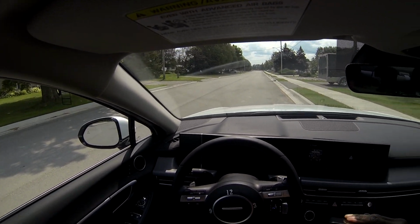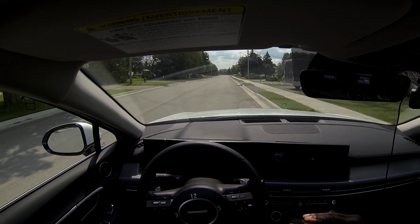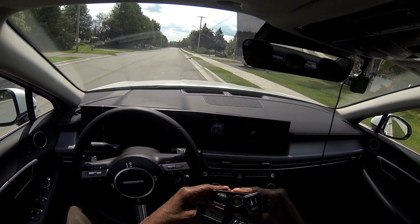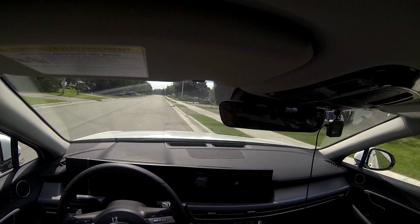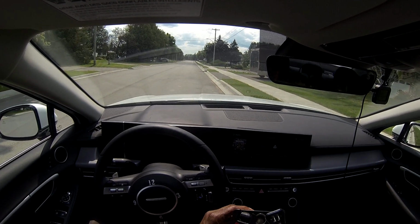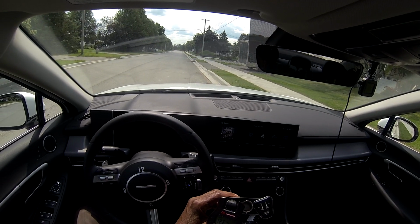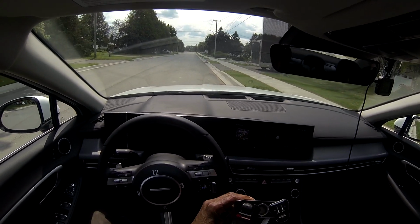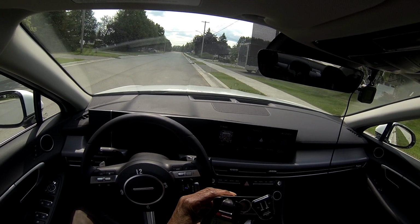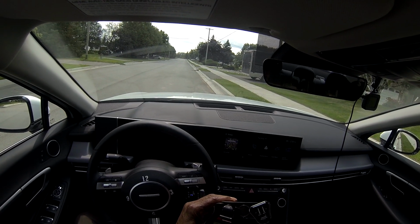Once I installed the new battery, the car started up, and then it went up to like 13 and 14. So just a heads up on this. I just wanted to let you know that there's a way of keeping track of your battery and your alternator. And you can see here it says 12.62, and that's with the engine off. It also says good. I hope you can see it. It says GOOD. And there's a drawing of the battery.